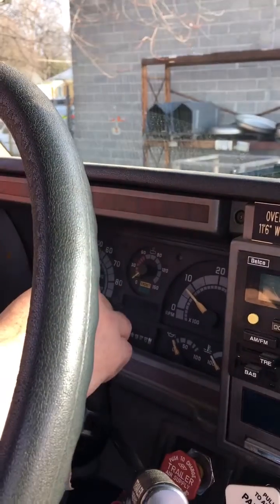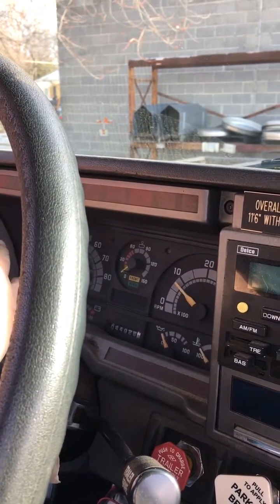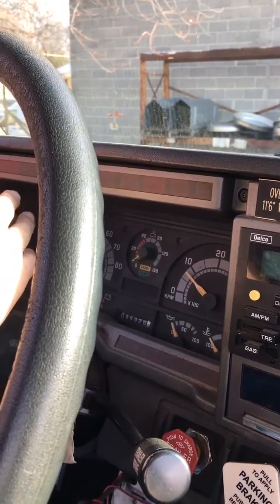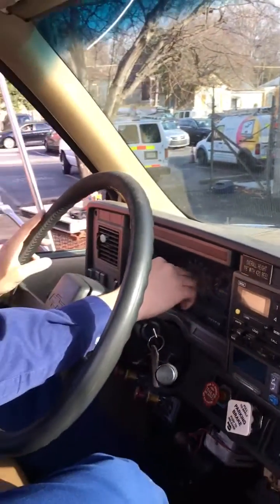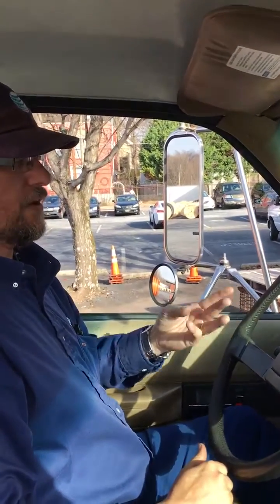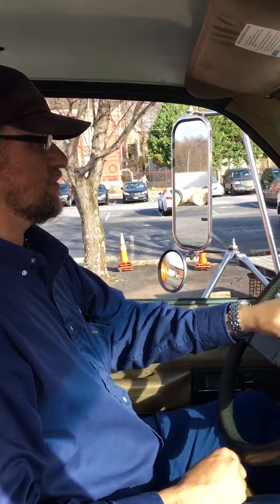Now my air pressure. Now 2 things to do on your air pressure gauge here. That's our air pressure gauge right there. One is we're building air pressure, that's why you gotta have the truck running, and the other is we have stopped building air pressure at 120. So make sure you include both of those. So that's all 3 of the 5s: 5 outside lights, 5 inside lights, and 5 gauges.